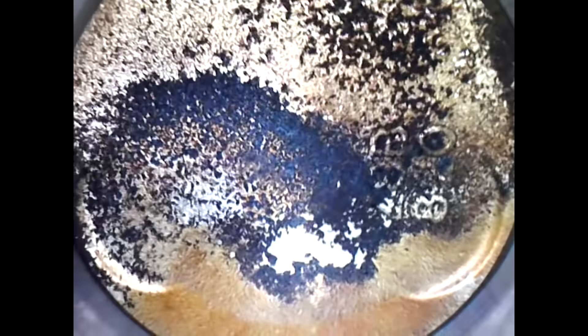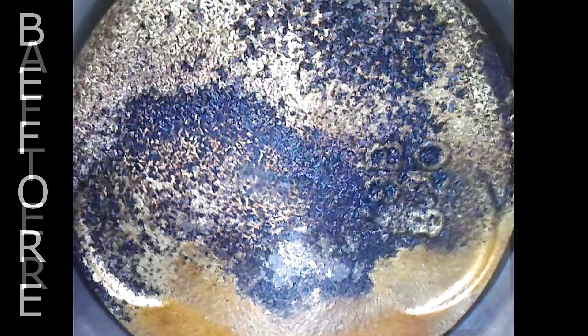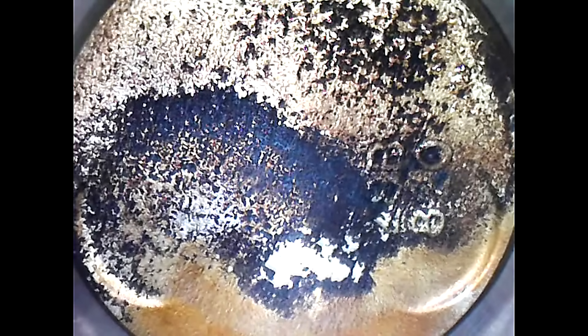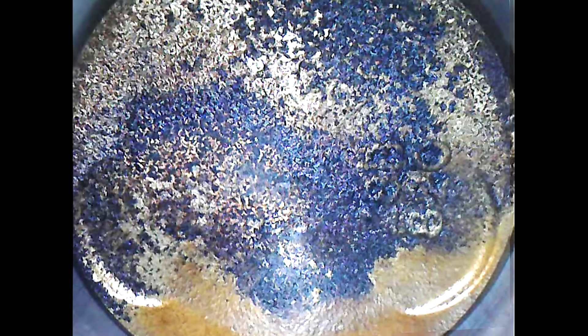This definitely looks better — I can actually see a difference. Let's get a before and after comparison to see what the seafoam actually cleaned. Here's the before, here's the after. You can see there's a big spot of carbon near the bottom that got cleaned off. The carbon in the area of the left valve cutout also got cleaned. The large light carbon deposits on the top side of the piston got cleaned up pretty well, and even the large carbon deposit on the top right got cleaned up.